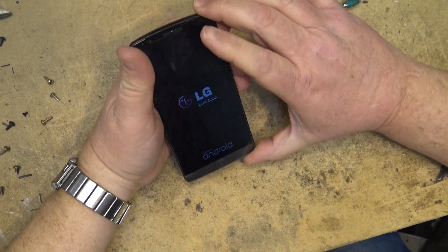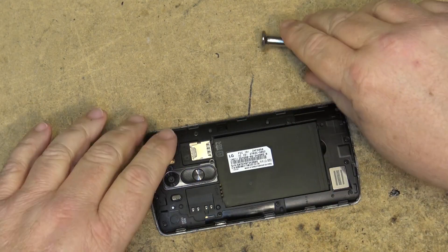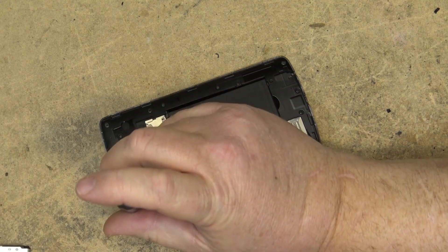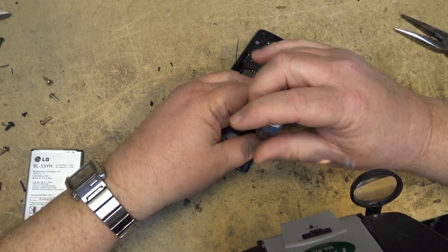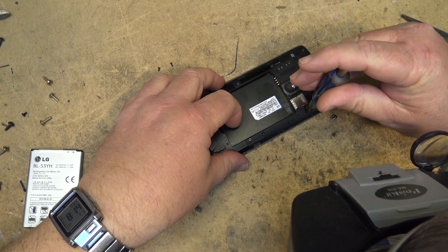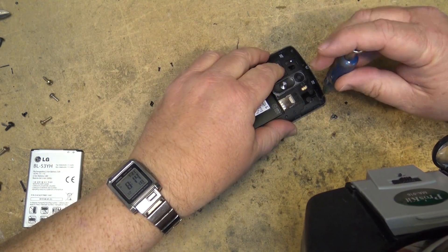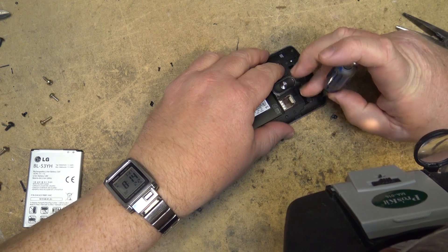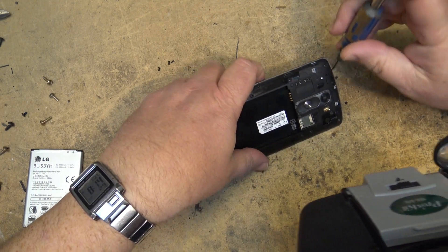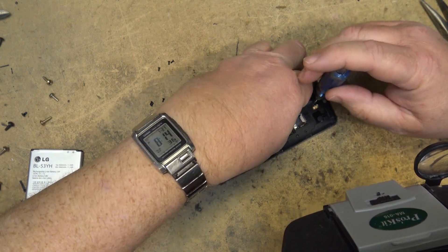From what I've read, it appears there's a connector that comes loose in here. This is a very common problem on this set. What causes it is that there is a small space between the SOC — the system on chip processor — and its heat sink. It can overheat and actually fracture the BGA solder connections between the board and the chip itself.